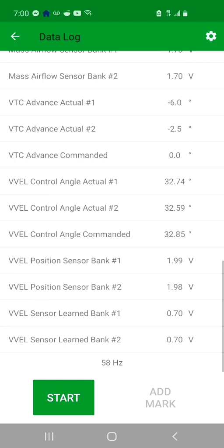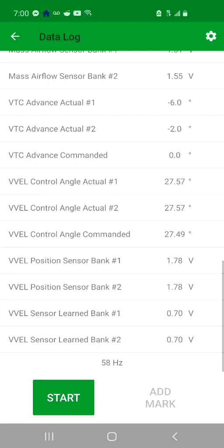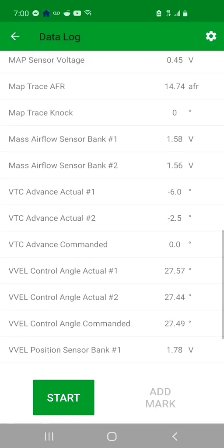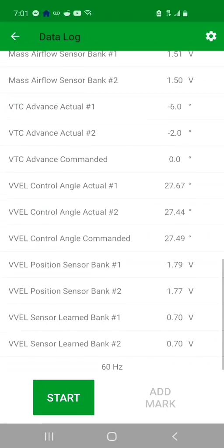I can see my VTC 1 and 2 is a little bizarre - I may investigate that. I haven't had this one running before. All I was messing with was the VVEL system. The guy had taken the ladder system out, hadn't synchronized it to the stepper motor, done a bunch of other wacky stuff, and burned up his VVL module. This VTC advance lack of synchronization can be some worn seals in the VTC covers, debris, or an obstruction going to the solenoid. It advances, but not like I want it to - that's kind of typical of what you'd normally see.